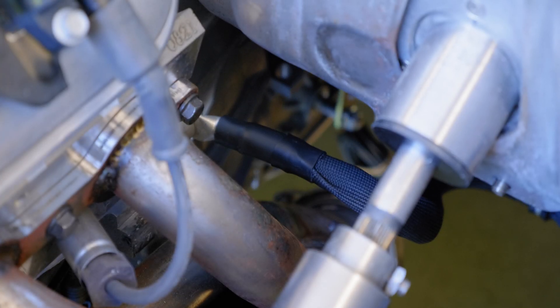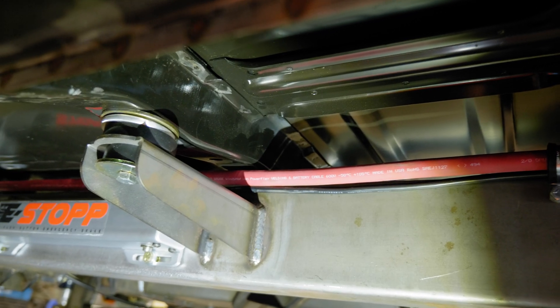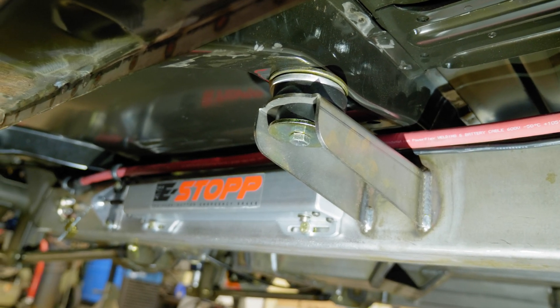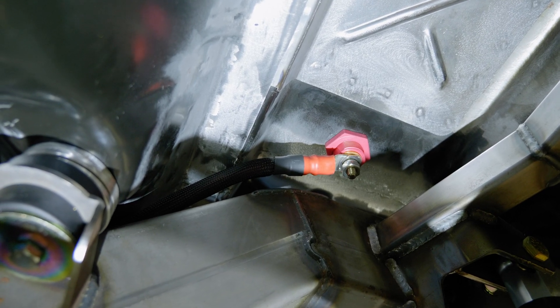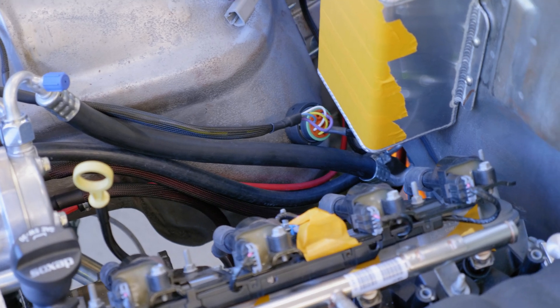In this vehicle I'm running double-zero battery cable to get really solid power and ground delivery to the LS3 engine. I also do this for aesthetics — I either want to hide cables or have them flow nice and clean so they're not sticking out like a sore thumb. A lot of factory vehicles run the battery cable floating out in the middle of nowhere because an extra foot per car on an assembly line adds up. For a custom project, we can flow down along an inner fender and frame rail for a really clean line. On the 55 Chevy I mounted the maxi fuse under the hood, hidden underneath the AC compressor, and the battery cable flows along the AC line so they all flow together.